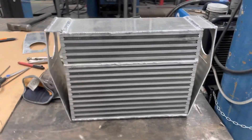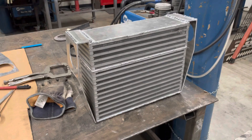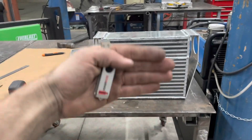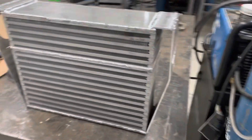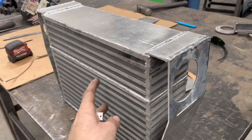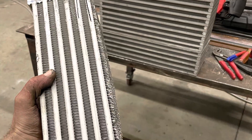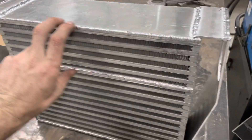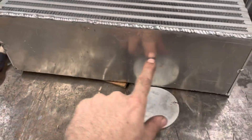Here is my custom intercooler that will be tucked for my S13. I'll throw in a couple photos so you guys can see my rough idea. This is going to be recessed behind the headlight brackets, tucked in back there. What I've done so far is welded two Garrett cores together — I was able to pick up two cores from Jack's Fab. You can see right over by my toolbox there's actually a section of it. What I did was cut it in half, dropped that one down, welded another core to it, then welded a cap on the top and a cap on the bottom.